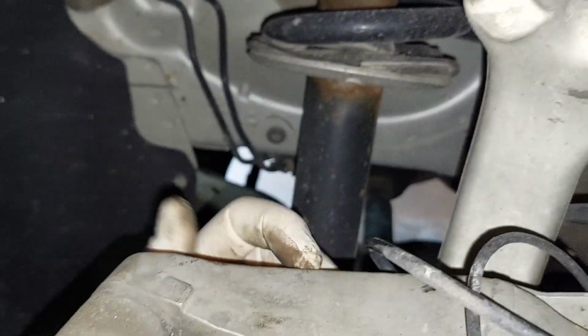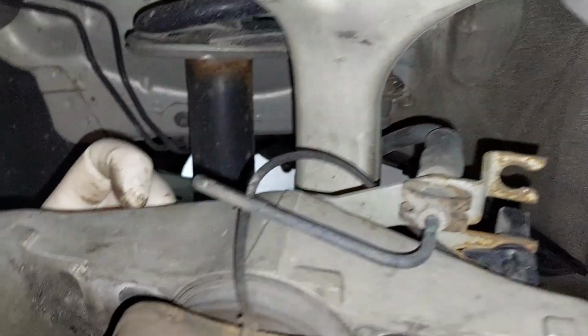Like I said, it's under braking. When you're about to come to a stop, you start hearing some creaking noise from the front brakes. I'll show you another thing it could be, but I pretty much isolated that out by having it occur while I'm just dead stopped and there's no pressure on the suspension. So I don't believe it's the lower arms, although I did buy one because the noise from them obviously can't be normal.